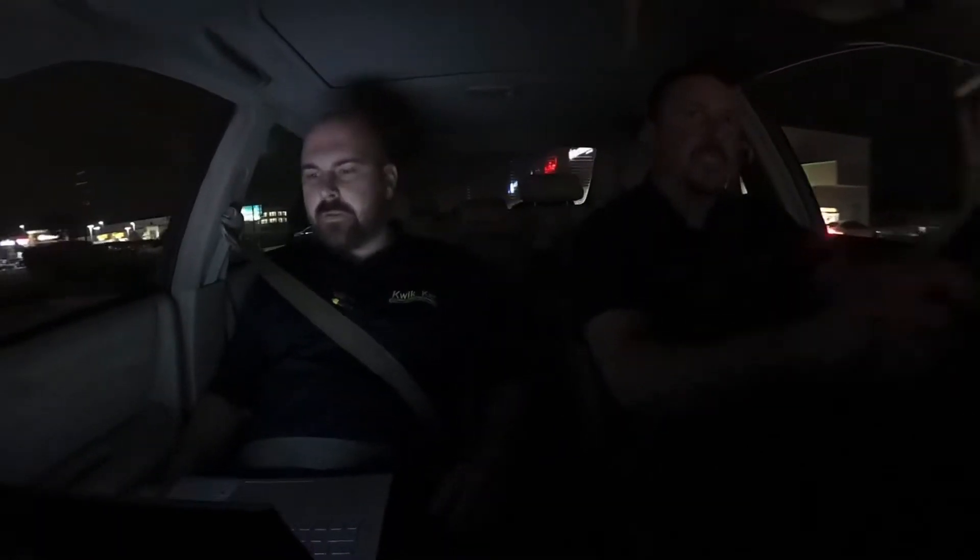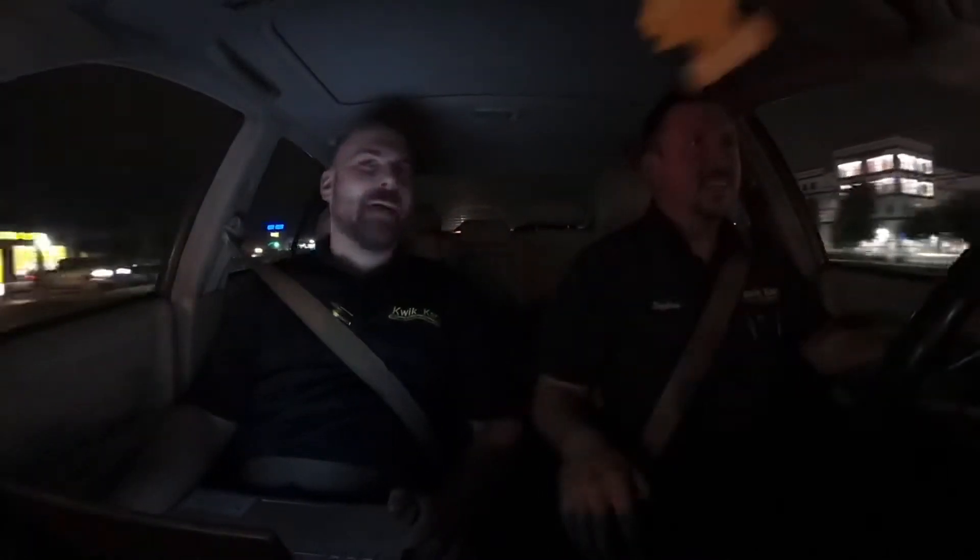We're dealing with cooling fans of questionable operation. Hit almost five pounds of boost just now and it didn't break up. The first time it hit five it broke up, but the second pull to five didn't break up at all, and no knock detected. It's scary when it does break up though — a very violent noise.